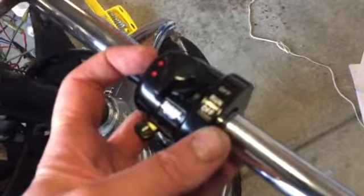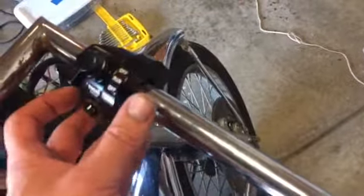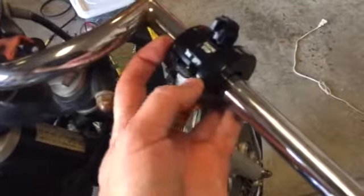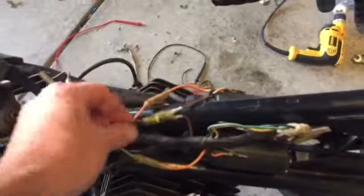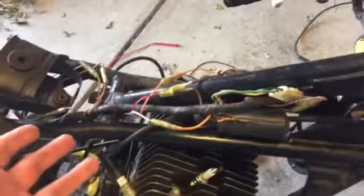This is a reproduction part — the original was missing. I was trying to start it and went looking for the kill switch and there was none. I think some of the wiring these guys had done — I showed earlier with the speaker wire — was to try to bypass the kill switch. There's a kill switch and an on/off switch that kills the motor. I spent quite a bit of time with my printed service manual notes, tracing back lines and making sure everything was hooked up right. Checked my ohms on the coils — they came out fine.